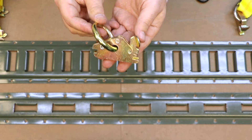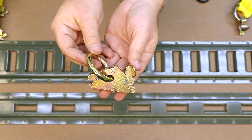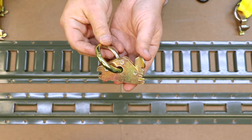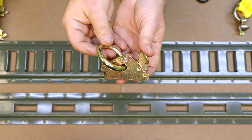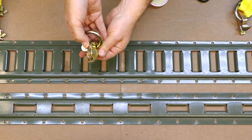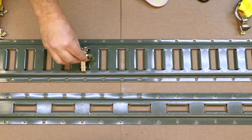The EFHD-KIHD2 is a 10,000 pound ultimate ring, e-fitting and ring assembly. This is an excellent device if you don't have a strap handy that has an e-fitting already on it. You can use this device to snap into the track by easily pulling back on this, inserting, and snapping in, making sure it's secure.